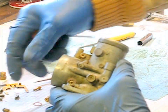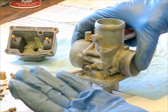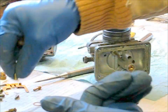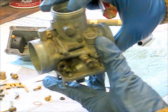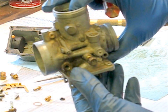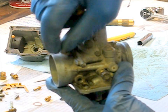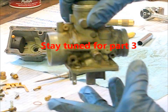There's a spring in there too that you have to take out. A little spring that goes in there. So, what we're going to do is shoot some cleaner up in that hole, blow it out, and put it back together. You tighten it all the way in until it seats itself — you don't have to crank on it, just until it seats itself — and then you back it out three quarters of a turn. And now it's set right where it was before. That's how you do that.